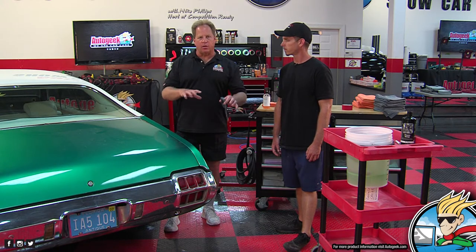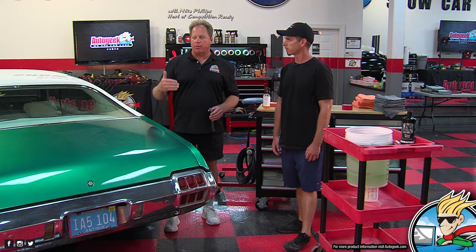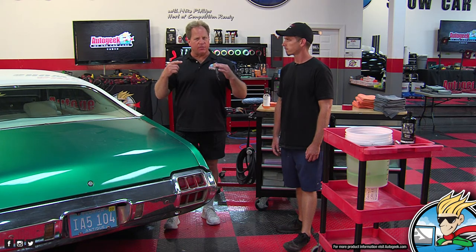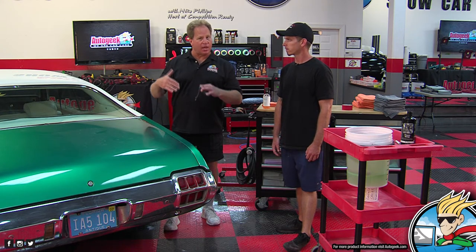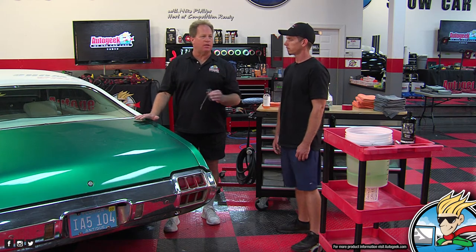order you a new fender and then they paint that fender to match the rest of the paint on the car, that would be a refinish or custom paint. Typically the painter's gonna put it on a little extra, especially if they know they're gonna sand it to match the factory peel. So there's extra paint there. But that's one of the times wet sanding is done if you wreck your car.